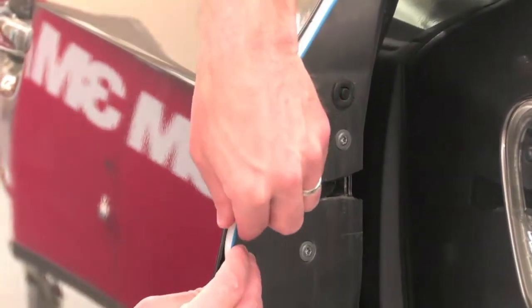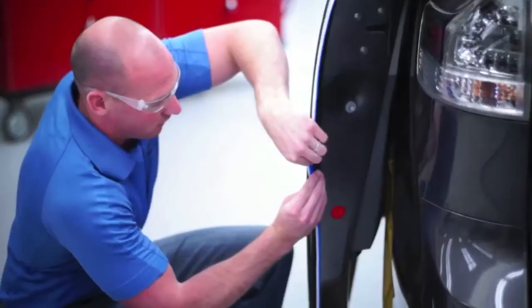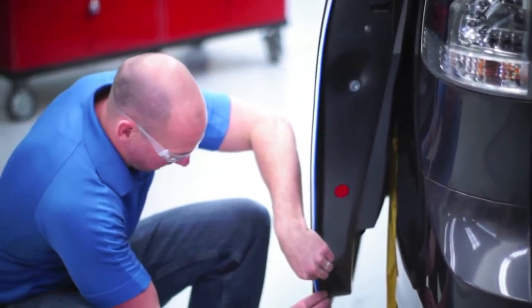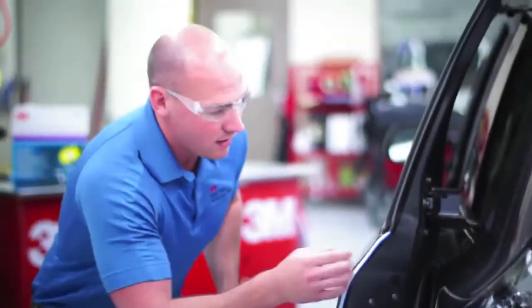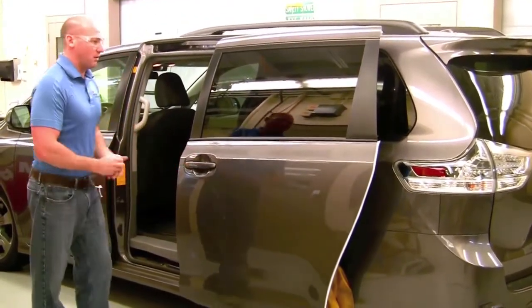You never want to impart stretch into foam as you're applying it, so I'm actually going to feed it into my hand as I'm moving down the door. I'm just going to be on the other side of the panel, just watching to make sure that my overlap is correct so that I'm able to slide into place at the end. After that I'm just going to come back and rub the whole length down to make sure that it's adhered well and we'll close it up and see how it looks.